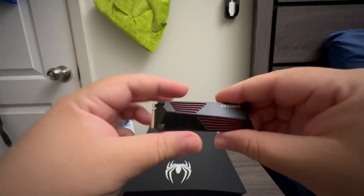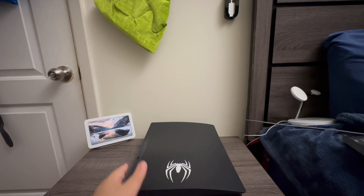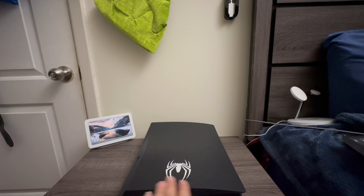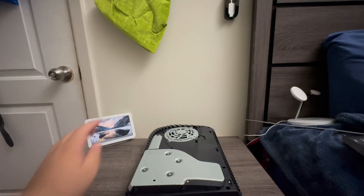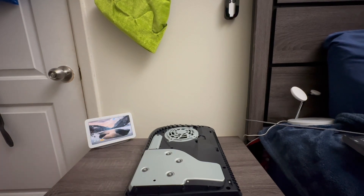So now what we need to do is remove the plates from the PlayStation. This is the side that has the disc — on the Spider-Man edition it's the one that is all black on the side and it has the Spider-Man logo. I have already pre-removed everything to make it easier for the video. This is where we have the slot for the SSD, so we're going to be removing that cover by removing the screw.